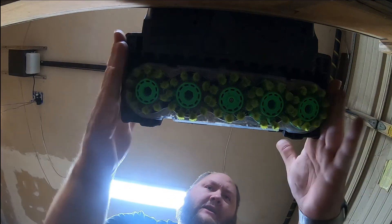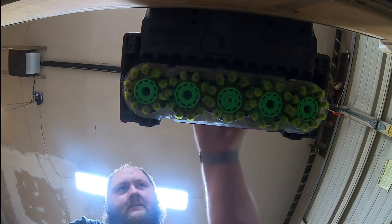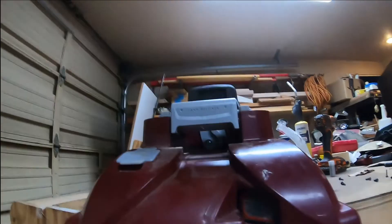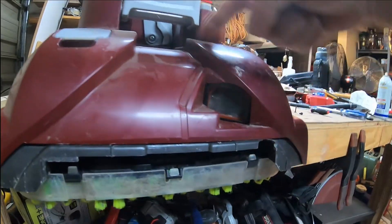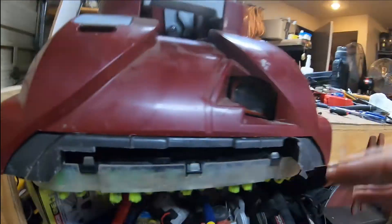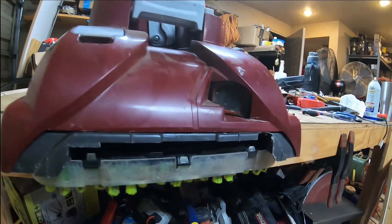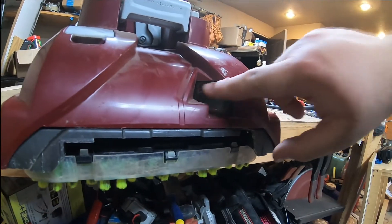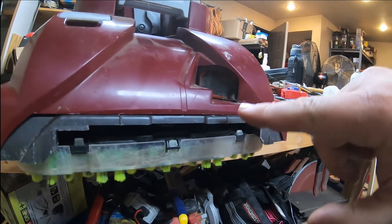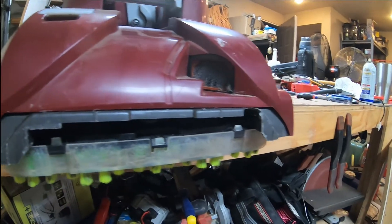This operates off of a negative pressure design. The air gets sucked up through the nozzle as you pick up debris off the carpet, and it has a bypass into the spin of the thing — air flows through and makes it spin. As the air comes in, it goes up into the tank and then back down, creating back pressure to force air through the turbine. Because of its location, there's a lot of moisture there, which is why mine rusted out. To test, I have it laid down and I'll need to cover the inlet hole to get enough back pressure to spin it.